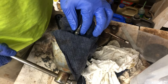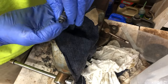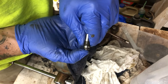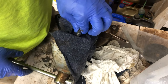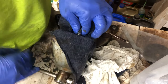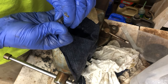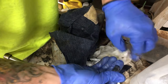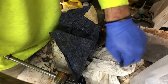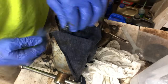As you saw, I was really able to start compressing that top part right there, and it was springing back perfectly. As you can see, that is an unseized hydraulic lifter, or hydraulic valve adjuster, take your pick. Finally unseized. This is what all of them have to be. They all have to be able to move that easy. The owner's manual says to prime with kerosene afterwards, but I found if you just stick them in the motorcycle, they'll self-prime with oil. So that's what I do.